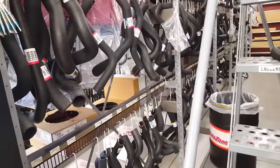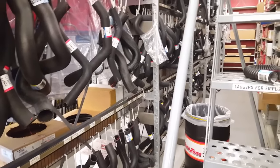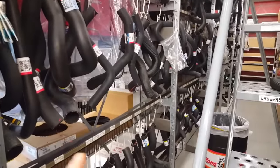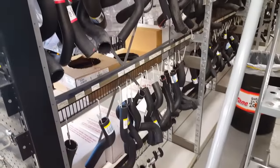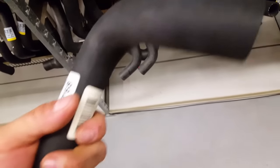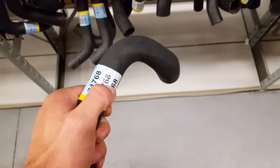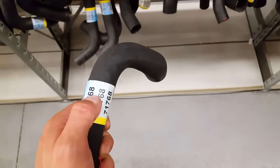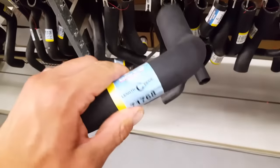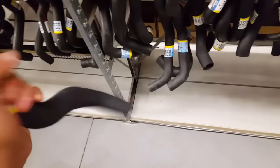The fitment of that inlet pipe is offset quite a bit. So I know that this is a good measurement here for what I need — I'm going to go around and just try all these hoses and find the one I need. This is an option — it might work. There's such a small distance between the thermostat and the radiator outlet. Come up, sit kind of like that, and basically I'd cut it right here. If it fits — it looks like it's a little bit bigger here than where my hand is. That'd be nice because the radiator has the tiniest outlets I've ever seen.